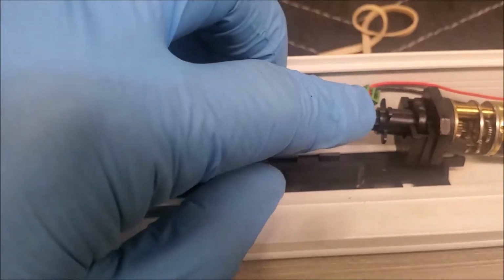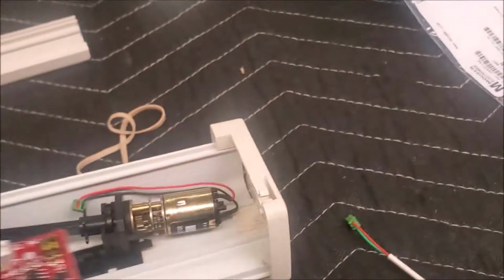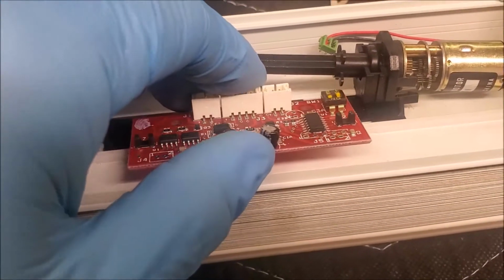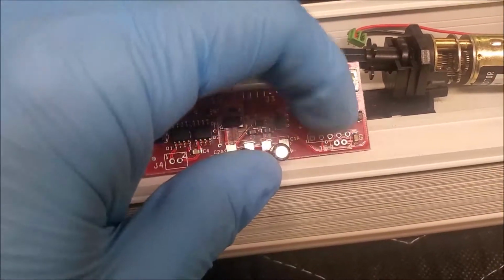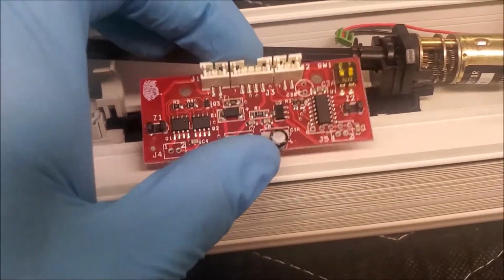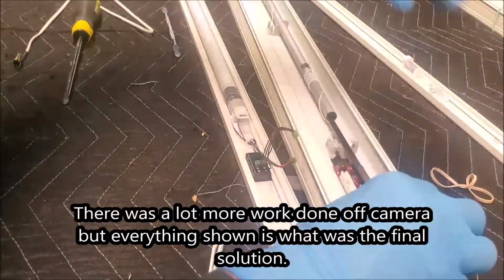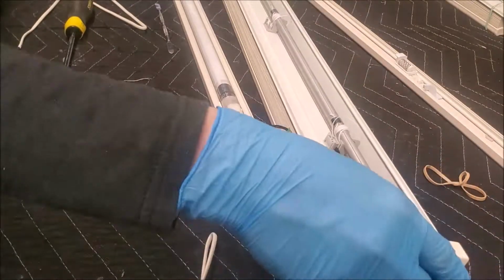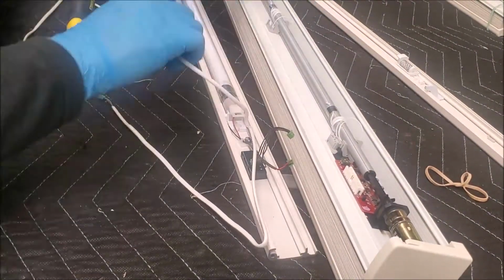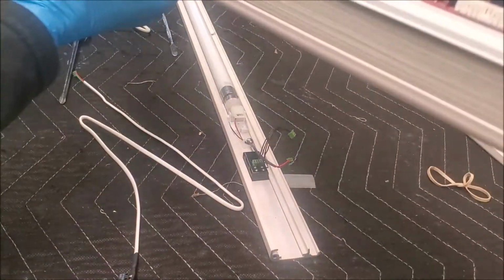see these little fins on the sides of that? There's 4 like a little crisscross. Those rotate through that Z2, and that is how it knows it's working. If it does not get feedback, it will turn off. So now that we know that, let's carry on. Folks, we're going to do a quick test before we put the switch in.